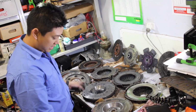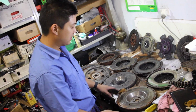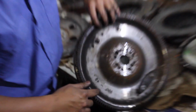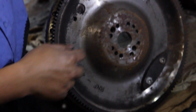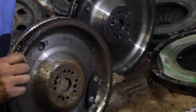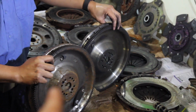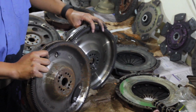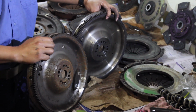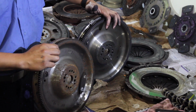Okay, the last assembly we have here is an actual 10.5-inch assembly. So it's got the same flywheel, same part number, with a bit of different drillings. You should notice that different drillings on there. This one here was run behind a Buick 3800, so that's the 3.8 litre V6 engine fitted to VN Series 2 through to VR. That's the Buick 3800, that's what we call it here.